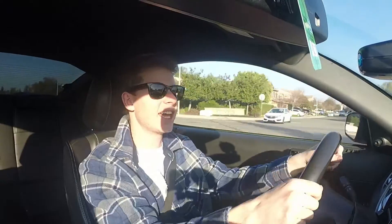The ride quality is actually still pretty nice — not too bad from stock. But the new tires grip so much better than my old tires. My old tires were so worn out it was ridiculous. These new tires have so much more grip — I'm so much more comfortable driving this car now. They're an inch wider all around, and my old tires had no tread left. I may get wheel spacers for the fronts just because they are so close to the brake caliper — maybe a quarter inch or smaller. Since they're all the same tires I can rotate them, but only front to back because they're directional. All right, if you guys enjoyed the video don't forget to give it a thumbs up and subscribe for more content — I'll see you guys in the next one.